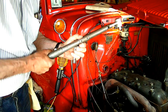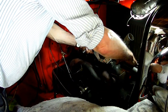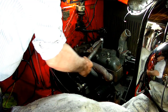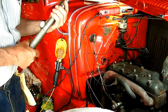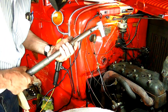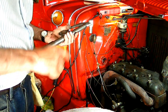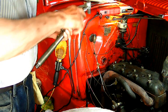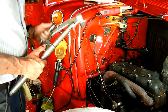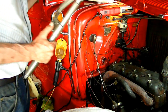So we're starting the next sequence at 40 foot-pounds, same sequence from the middle to the edge. Then the last sequence is 50 foot-pounds. After that, you reverse it — go from 14 to one, instead of one to fourteen — then back again to one. So that's five steps total: full torque on reverse. Then we have to heat it up, take the distributor out, and go all through the whole thing again — though you can't do that one with the distributor in.